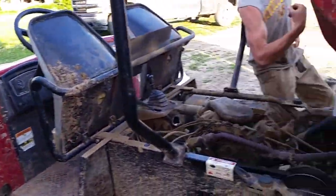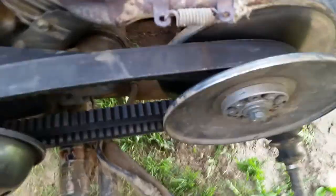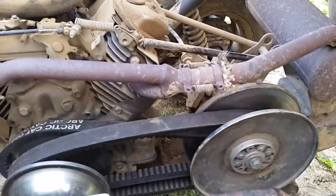Today the Trekker decided that the clutch wanted to be shot on it, so we tried a couple different things. We tried putting two belts on it so that the rear spring is gone, but no matter what it just either slips or binds.